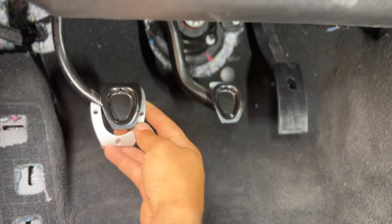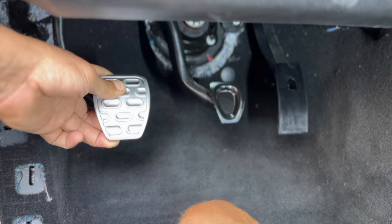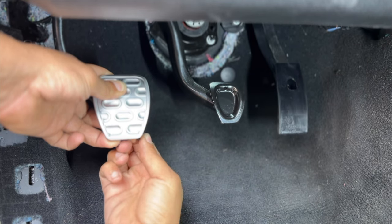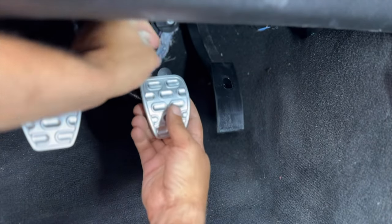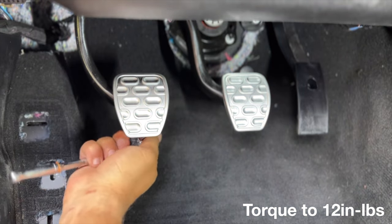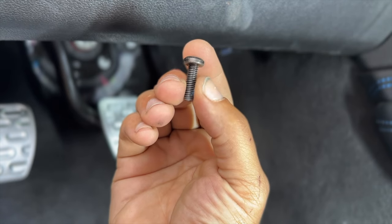Back over to the brake and clutch pedal, slide the cover retainer onto the back of the pedal pads. Using the supplied M4 screws, secure the retainer to the cover hand tight. Each pedal is grooved to recess the factory pedal. The retainer is then mated to the RTR pedal cover for a secure fit. Once in place, using a T15 Torx driver, tighten the eight screws and torque to 12 inch pounds.